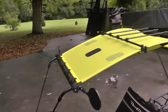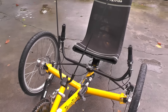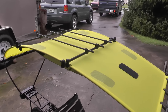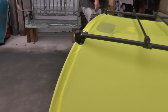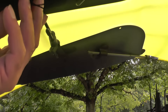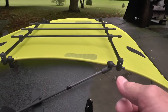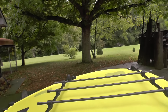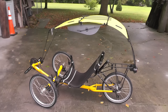Essentially a standard canopy with a quick disconnect. We drilled and tapped the front derailleur tube with a quarter-20 and put the quick disconnect in there. He's got the visors on there — there's a little stay and a tab. The visors move with this little knob back here, and to get it to stay out, that little clip slides over and latches underneath the visor.